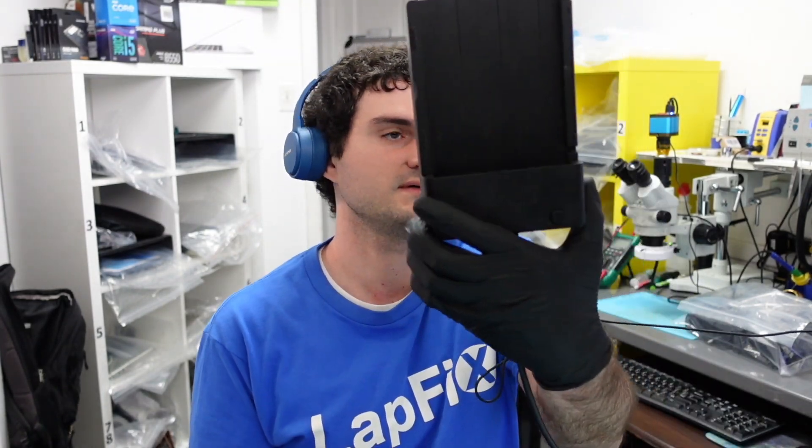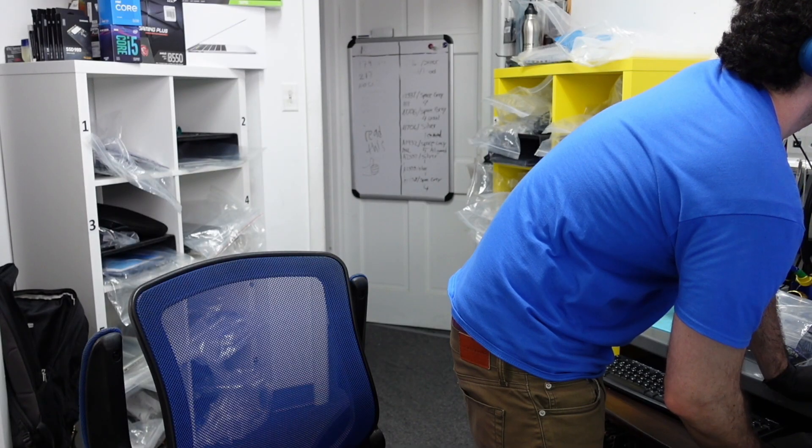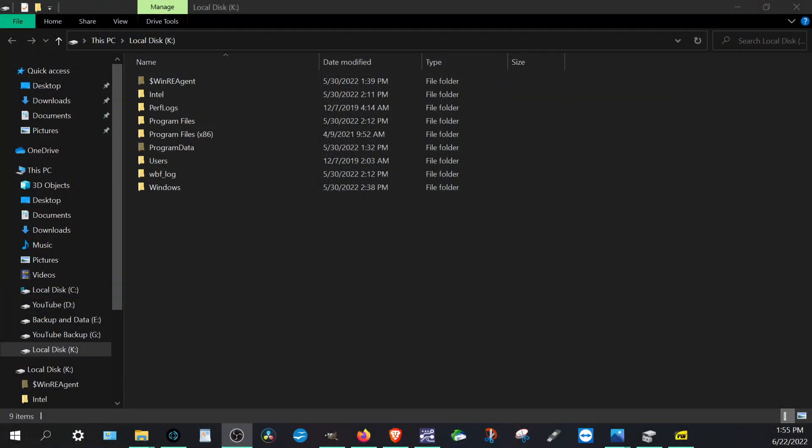It's all been repaired — let's go ahead and plug it in. I have my adapter here, and it did come up. Switching over to screen capture, we can see this is Local Disk K, and it looks like there is an operating system there — which makes sense because this is an OS drive. There's obviously user data there but everything looks pretty good. We successfully repaired the Samsung EVO 860 one terabyte with a PCB issue and were able to extract the data for the client.